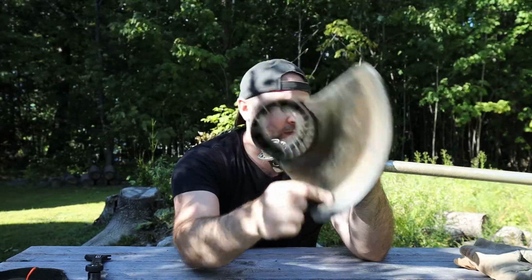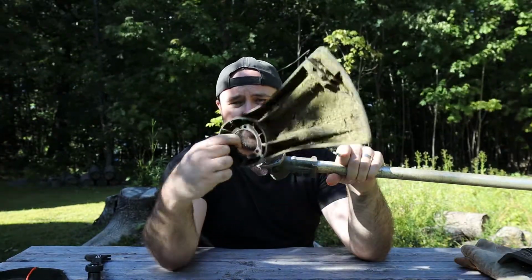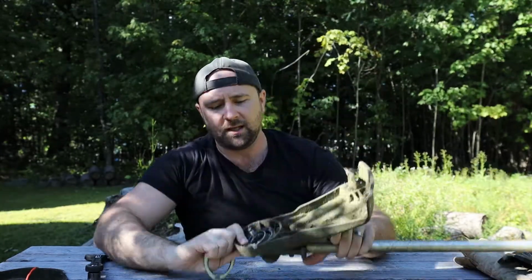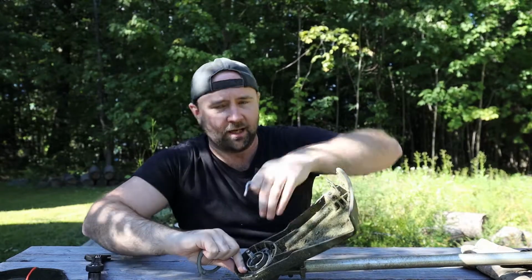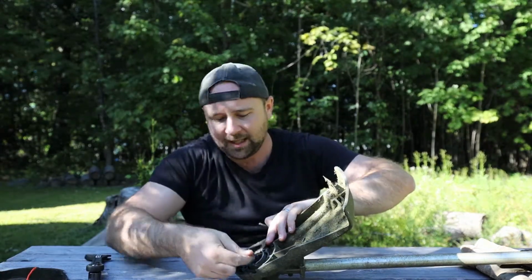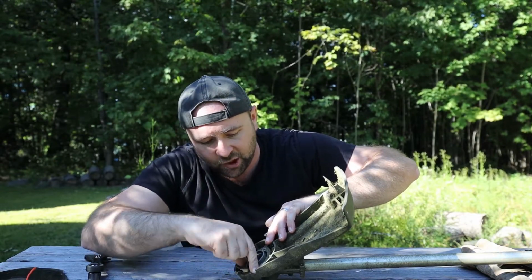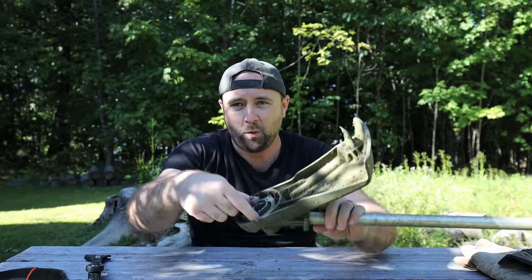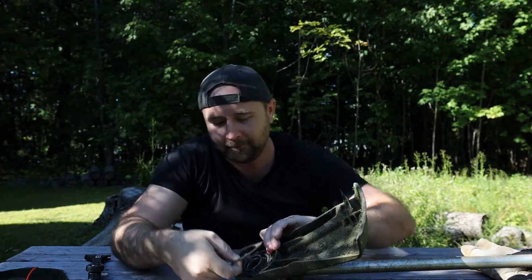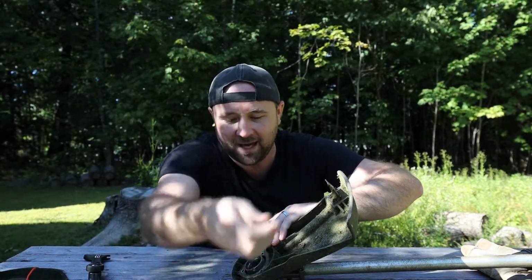Take the blade guard off, set that aside, and we're going to bring this longer, narrower string trimmer guard into view. We're going to set that right on here, line it up with the shaft of the trimmer, and take this metal flange and set that right down. It is kind of a triangular shape. I know there's a word for that shape there. Someone in the comments can let me know, but I don't remember what it is off the top of my head.